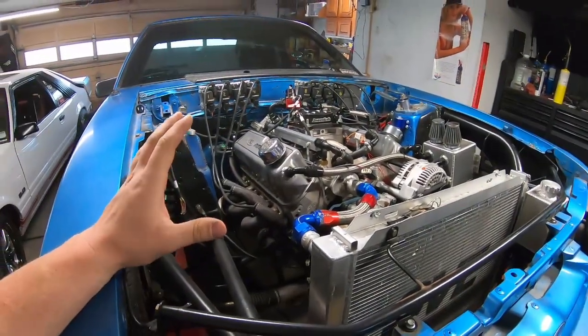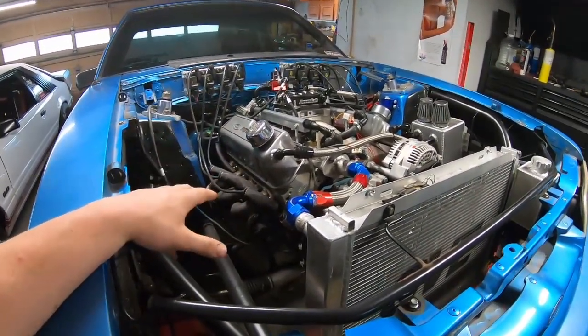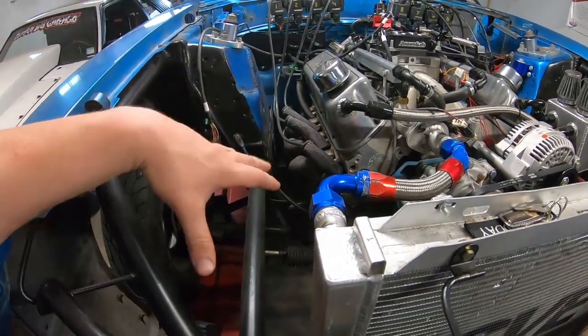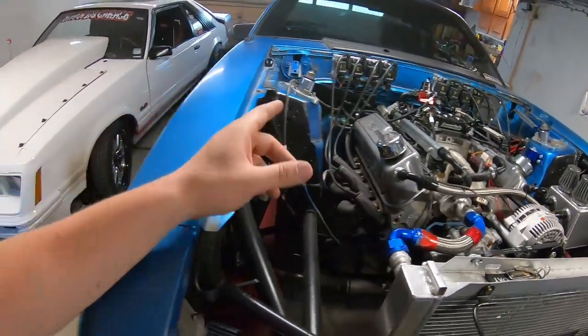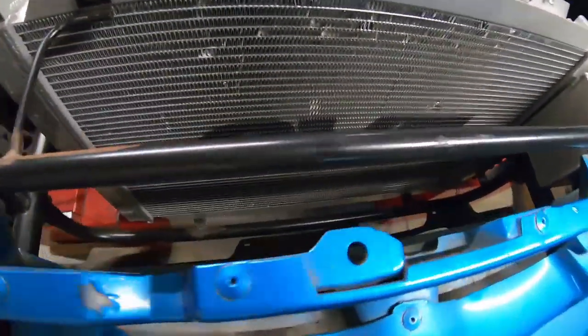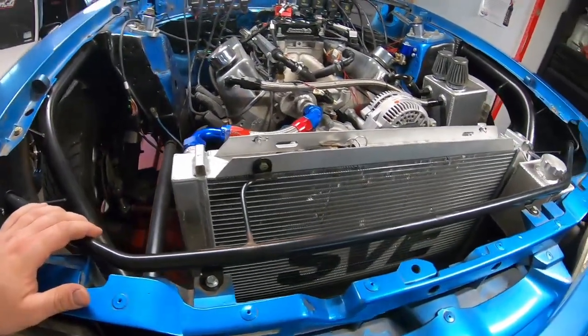We are going to be making some tuning adjustments and getting this thing tuned right. The next thing besides putting a base tune on it is he's going to turbo it. The turbo is going to go right here, he's going to put a 4-inch exhaust dump that'll end up probably down here, and then we're going to put a 5-inch intercooler that I'm going to fabricate. It should turn out awesome. In the next couple of weeks I'm going to start getting back after it. Hopefully you guys enjoyed this one and I'll see you in the next.